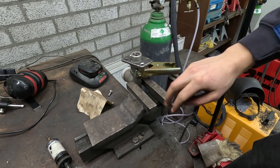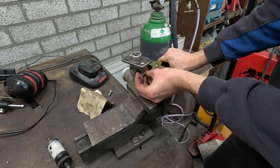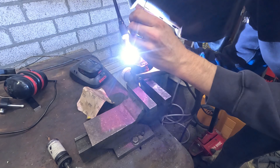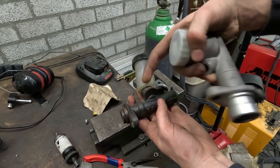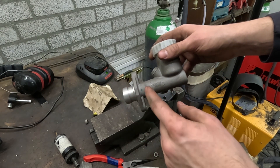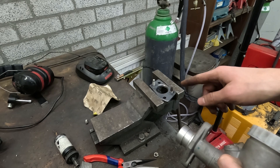These are the new master cylinder — it's a Land Rover unit. I made a little adapter plate which adapts it to the Miata chassis, and I will be welding on the stud from the back, so this will serve as an adapter. The original Miata one has a different bore size internally compared to this one, and the Land Rover one matches the diameter of the original BMW one. I didn't choose the BMW one because it has a plastic housing, no internal reservoir, and the mounting is right there instead of the flange type — this is way easier to produce and make fit my car.